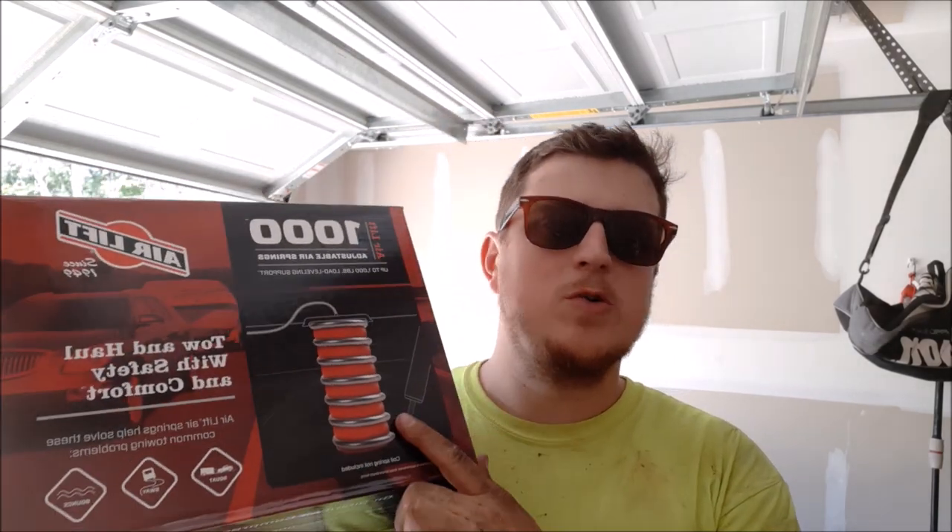We'll be using it to move cars around. On the newer Dodge Rams they have coil springs in the rear, so they're really well known for sagging out super easily. Apparently these AirLift 1000 series springs are supposed to help that out. I'll put a link in the description if you want to check them out. They also make them for Jeeps and other vehicles with coil springs. The traditional style that mounts at the axle is a lot more expensive. It's worth a try if it helps make us more stable while towing — that's a win-win.